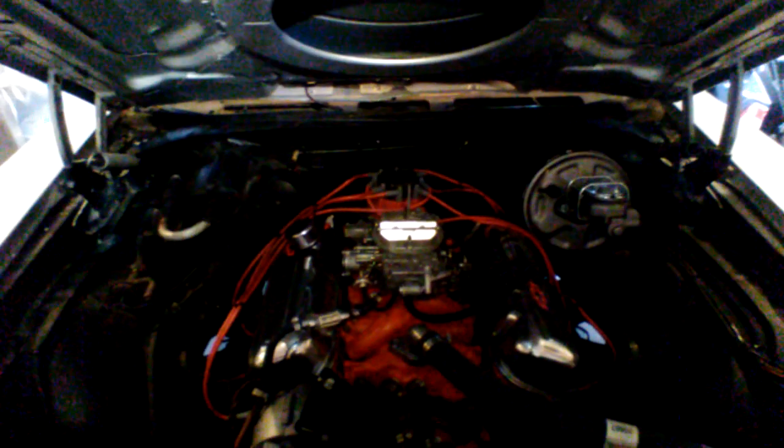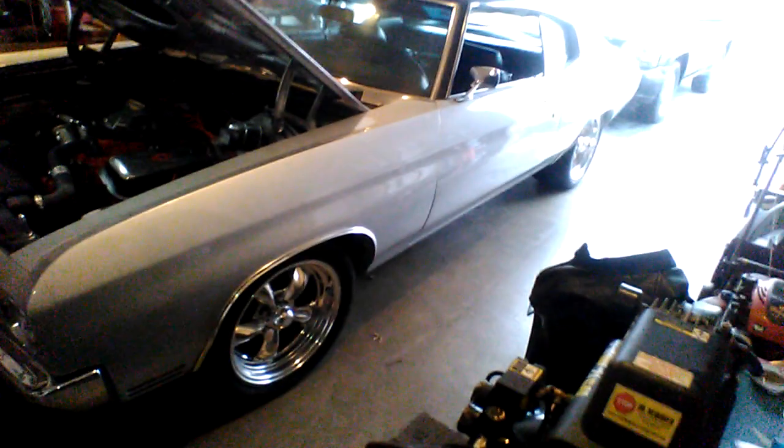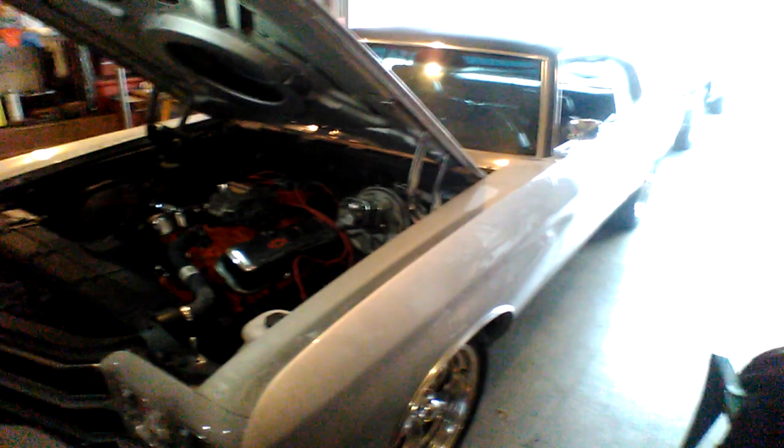Put that smaller air cleaner on there for you. I'm going to make a couple of carb adjustments. I've got to put that vacuum port underneath the carburetor, so I've got to take it off and install the vacuum port. That's going to get us a vacuum line that comes around to the brake power booster right there. With the smaller air cleaner we'll have better hood clearance, because right now it's rubbing. The quick solution is put a little bit smaller air cleaner on there. We're waiting on some parts — I thought I'd make you a video so you could see how it sits with the new rims. Everything's coming together. Good guys, automotive performance — we'll see you at your next service.